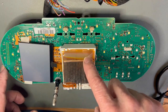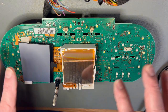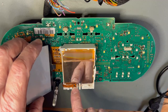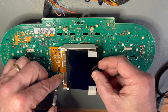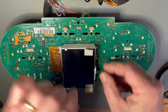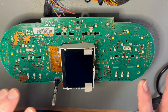We've refitted the central diffuser that the LCD display is mounted to. In this case we've actually added another layer of film underneath the diffuser films in here, because this further darkens down these displays — even though this is a good quality one, it's still a bit brighter than stock, and this gets us down to pretty much stock levels. To get this back in, very carefully lift the ribbon over, slide the edge of the display underneath these two plastic tabs, draw it along making sure it stays in place, and that's now locked in place.